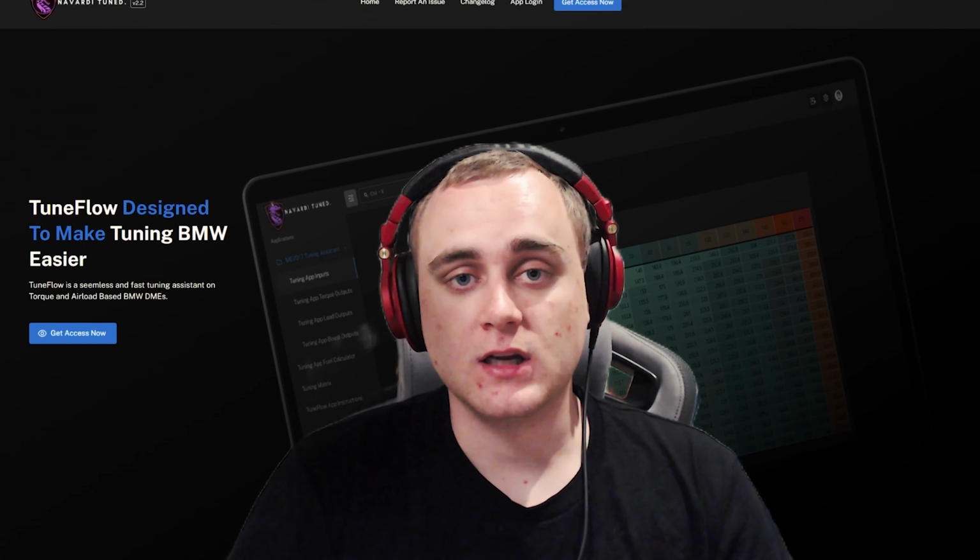So if you work out the size of the bore for the piston, if it's 84 mil, it gives you about 7 millimeters total thickness between each cylinder, but then each cylinder has about 3.5, right? Collectively it's 7, but divide that by 2, it's 3.5 millimeters. So when it comes to adding in these sleeves, we removed the coolant passage between cylinders, pretty much removed it.